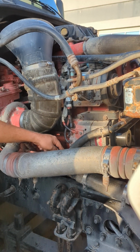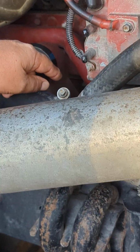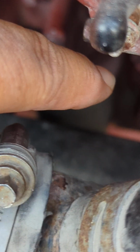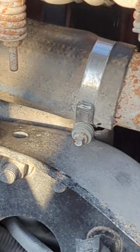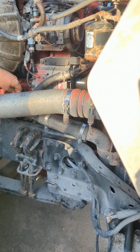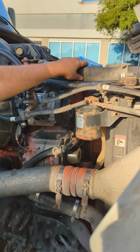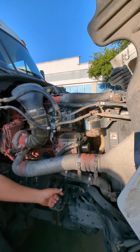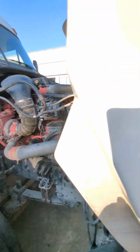I'm going to go down to my water pump. It's properly mounted, secured, not cracked, bent, or broken. Is it that thing right there? Yep, right down in there. There it is. And it's not leaking. It's also belt driven, right? And that belt also should be no more than 3/4 inch play. And then my water hoses, properly mounted, secured, no abrasions, bulges, or cuts, and they're in good working shape, right? Let's move over to the other side.